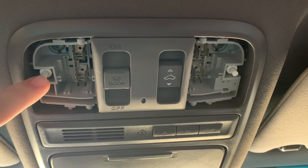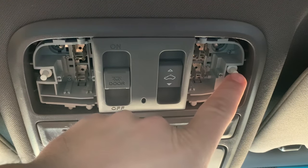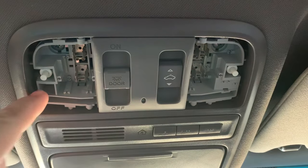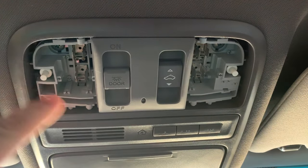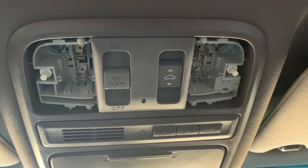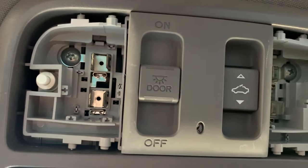With all that out of the way, you now see these white pins right here. These are actually the switches that push in to turn on and push in to turn off. And I think that is our culprit. To get those out, we're going to have to remove this whole assembly here. You'll see that there's a screw on each side that we're going to have to remove first, and then the whole assembly will pull out.